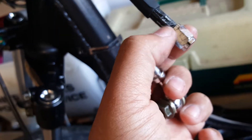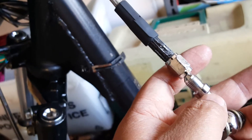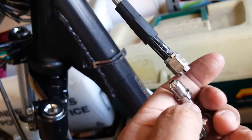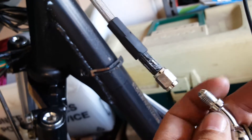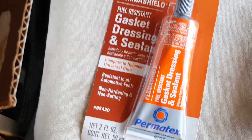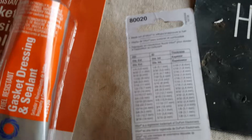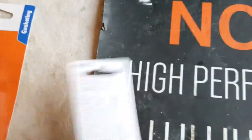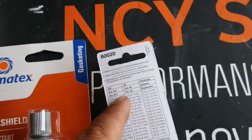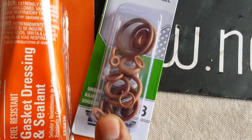It seems like it's leaking out from the very top of this port. If it were leaking from the bottom it would squirt right out already, so that's a good sign. It's not that hard to fix — pretty much just getting a rubber seal in here and putting a little of that special heat-resistant silicone on the threads. We picked up this Permatex gasket dressing and sealant — it's fuel resistant — and also this Viton seal, which withstands exposure to fuel.